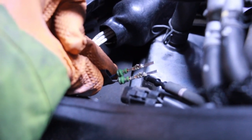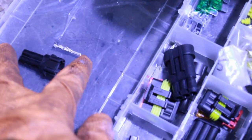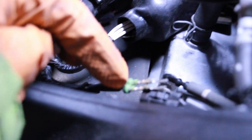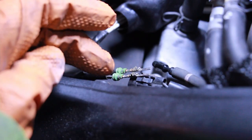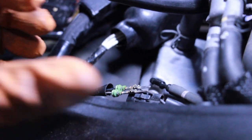Now those pins there, we have some spares. So what I'm hoping to do is wire in with a pin. This is the plug. We have a spare, and we've got the bits we need. And rather than splicing or anything, we're just going to do a double wire onto that pin, so it's a nice, neat OEM fit. That's the plan, anyway. So the other thing we're going to find before we mess with anything else is the plug for the RPM. Then we'll put this back together briefly and just pin in on the back of this and check that we actually get the signals we want. And we'll go from there.